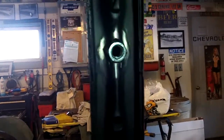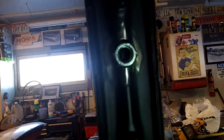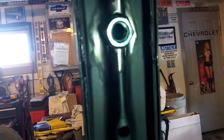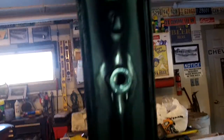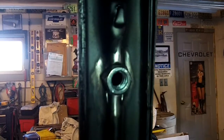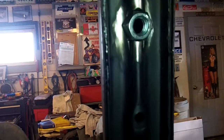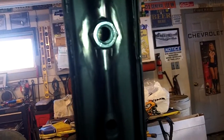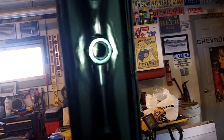I wish I had a better way to hold the light here. You'll see that raised rib that runs down the middle here. I basically just took a chunk out of that, and the nut is actually thick enough that I bottomed it out on the inner flat part of it, and it's completely flush — it works out perfect. So with a little trimming with a cutoff wheel, a die grinder, and a flap wheel to get some bare metal, I have that nut placed where I want it. I'll clamp it with a vice grip and burn it in all the way around really, really good.